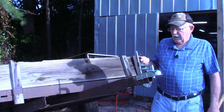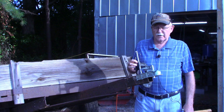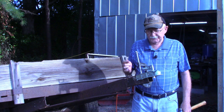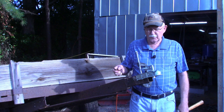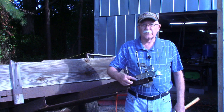During the 2 weeks it took me to get this, I had occasion to be at a couple locations that sold trailers, and I made it a point to walk out and look at them. Trailers, log splitters, various different utilities that you pull behind a vehicle. And it was about 50-50 percent on how many of them were actually welded into place, like the one I took off of this, and how many of them were simply bolted. I didn't see any that were bolted and welded. I think what I'm going to do today is bolt this one. I could put a good weld across the top here, but my vertical weld skills aren't that well.